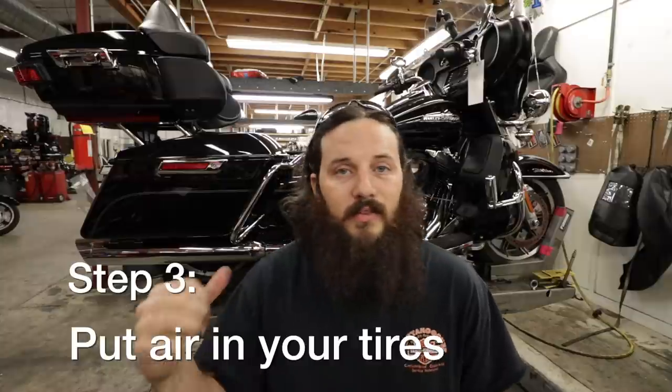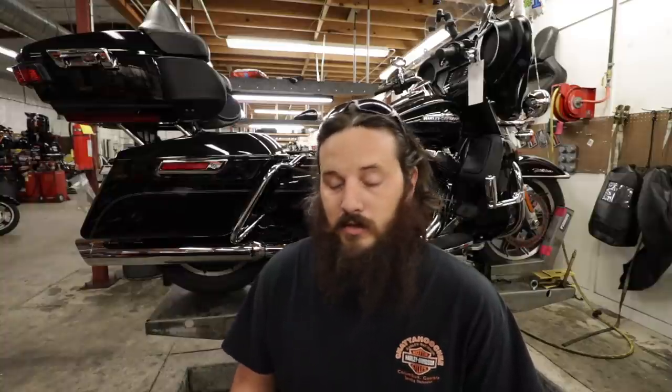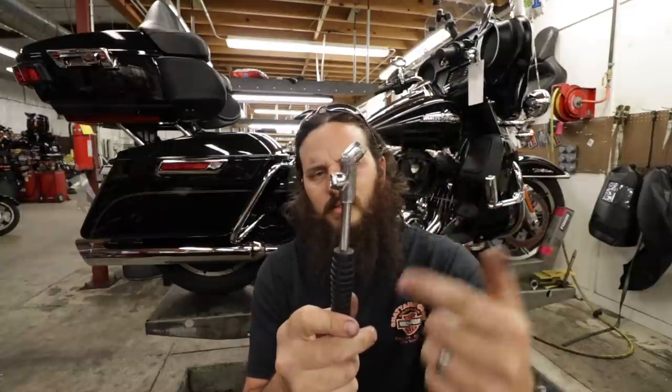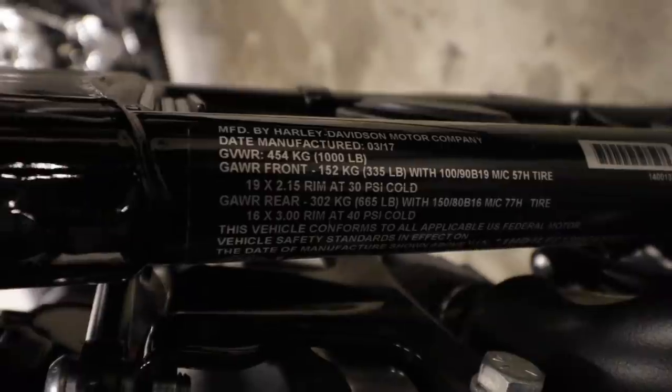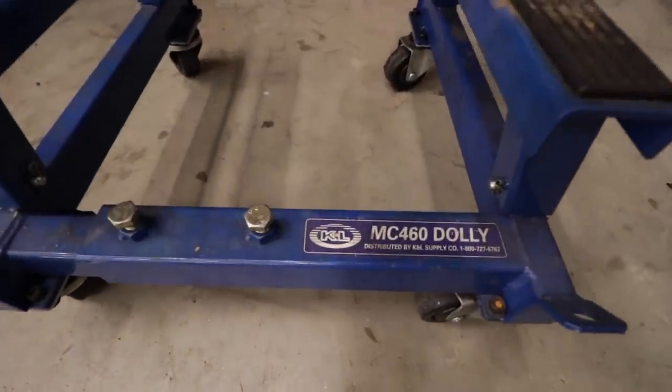While the oil is either draining or filling up, best bet is to put some air in those tires. You already don't really want them to sit in the same spot and get flat spots on them — you certainly don't want them to do it while they're flat. Air them up. I use one of these guys — makes it super easy to get on the valve stem and tells you what pressure it is. If you don't know how much air goes in your tires, there's a sticker on the side of your frame that tells you front and rear tire pressure, just like cars have one inside the driver's door. At some point put it on either a blue dolly to keep those tires off the ground, or a motorcycle jack. Or over the next couple of months just roll it around so it doesn't sit in the same spot too long, because nothing ruins the handling on a motorcycle like two flat spots.